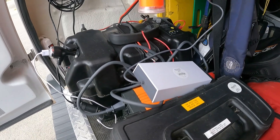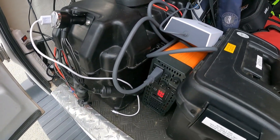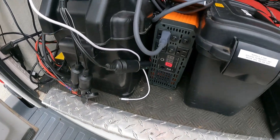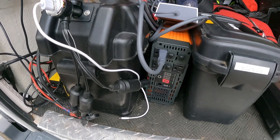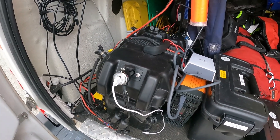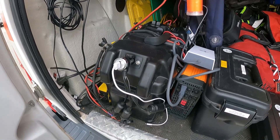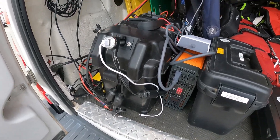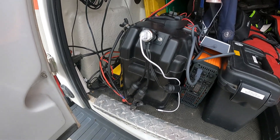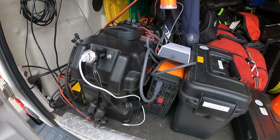We're going to power the system from its 120-volt power supply for now, and will later use a 12-volt DC to 48-volt DC converter in a later install. We plug the power supply into a 12-volt to 120-volt inverter connected to a 100-amp-hour battery. It is charged by the truck's 12-volt system when running, or we can plug the truck into a 120-volt source like a generator when needed. The battery can run the Starlink for a few hours.